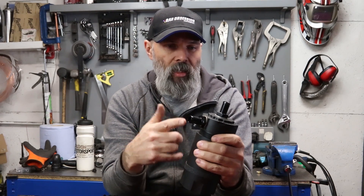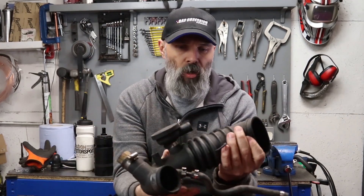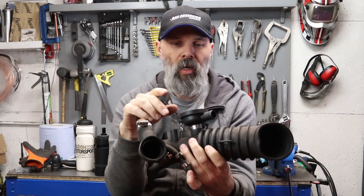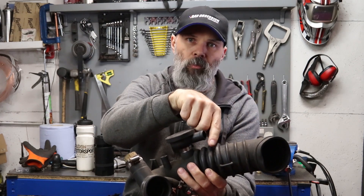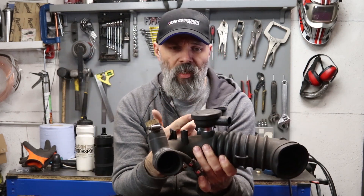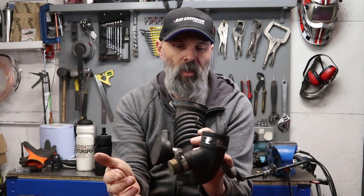I just need to screw this back in and get that hooked back up to the hoses. One other thing worth mentioning — on the standard turbo intake, which seems remarkably small, so obviously that's turbo side and intake side. As the air goes through, this — what's called the hockey puck — is a pressure regulator. If I didn't have the catch can from the back pipes and everything else, this is where the hose would be coming in. I'm actually going to remove that and just connect from the catch can straight back in. I'll set it to one side in case I need it, but I think with the way the catch can works it's going to handle that regulation anyway.